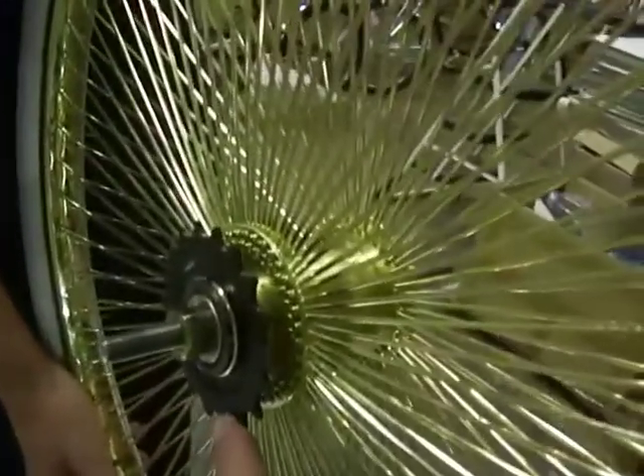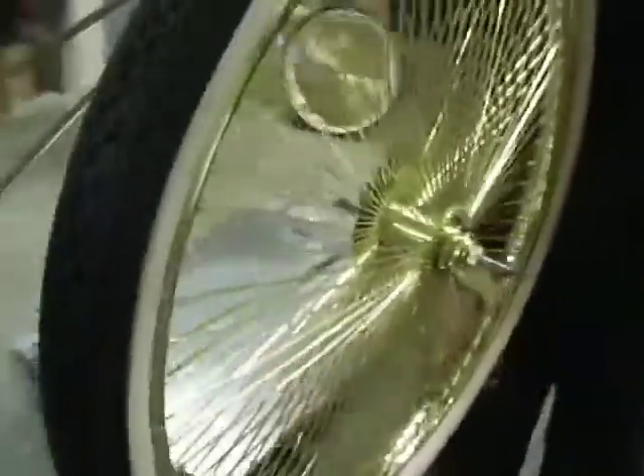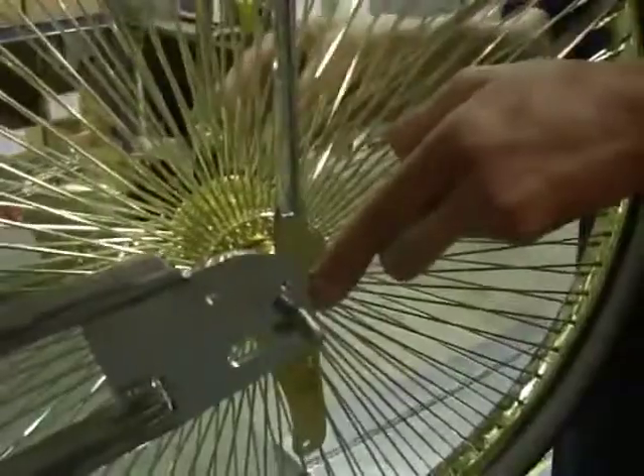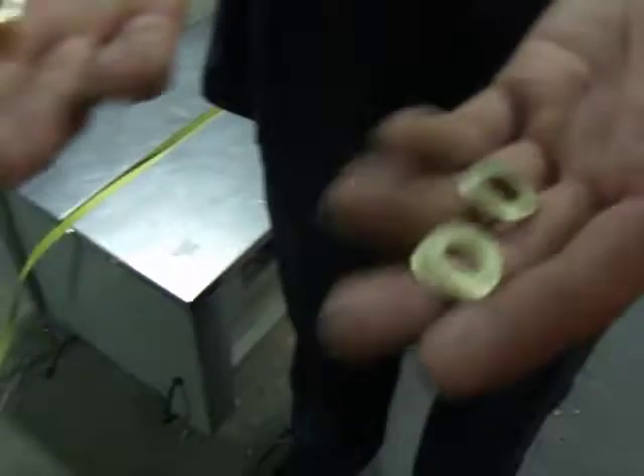The sprocket is going on the left side because on the frame the front sprocket for the cranks is on that side as well. Go ahead and put it on, just put it in there. Now we're putting on the fender braces — we put on the rear one first, then the front fender brace second, looping it into the rear dropout. There's the coaster brake arm right there.